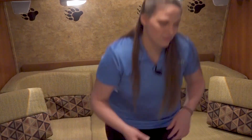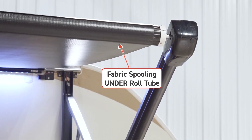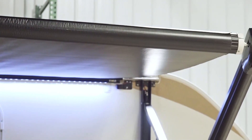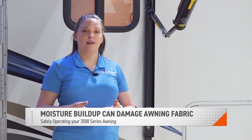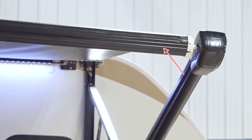For safety, when operating this awning — whether using automatic or manual extend — you have the opportunity to overextend the roll tube so that the fabric orientation ends up underneath the roll tube instead of on top. The fabric should be over the top of the roll tube for optimal water runoff. If the direction is reversed, water will gather at the roll tube, shortening the life of the awning fabric and creating mold and mildew buildup. To fix this, retract the awning; this will extend and then correct the orientation of the fabric.